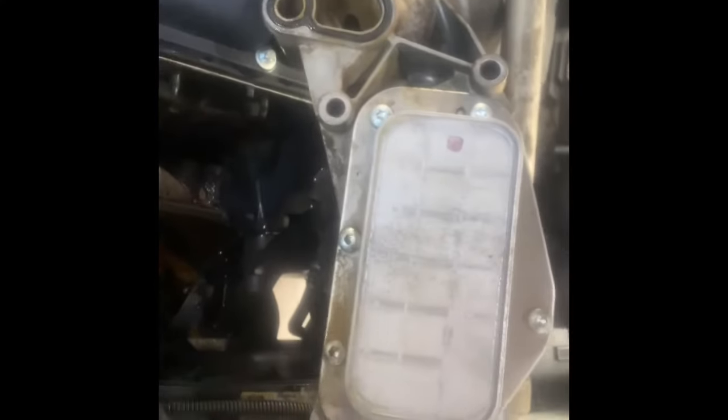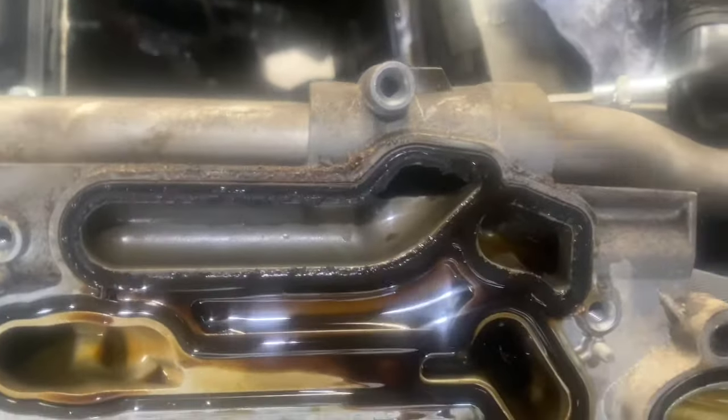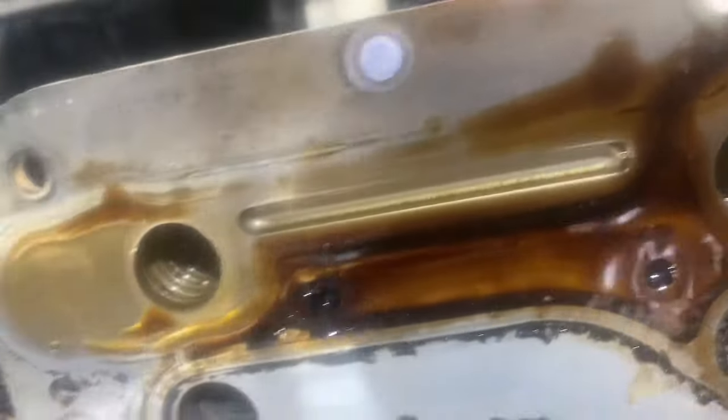You can see that's where it was leaking from on that side. Make sure you clean the area up first before you fit the new seals. As you can see from this video, it's a T30 star torque to remove these bolts on the oil cooler housing. The bolts are out - get a little lever bar and try to gently prise it up until it pops. Eventually it'll just come off - that's where the seals are. There's one channel for the oil and one for the water; there's a clear one for the water and the other one is for the oil. Replace those seals and refit it, and remember to clean the area before refitting so that it sits properly in the seals.